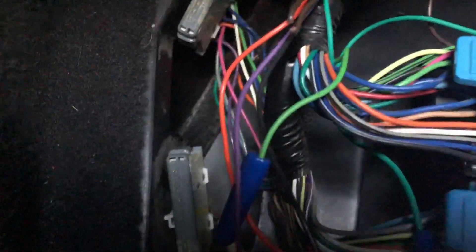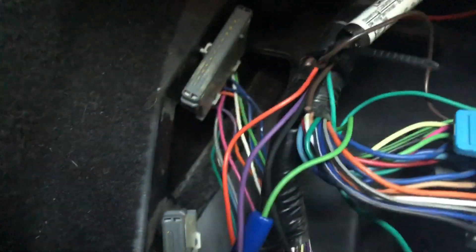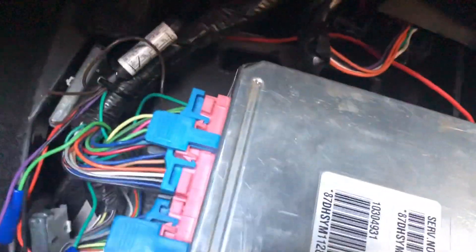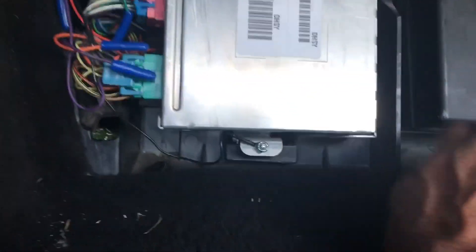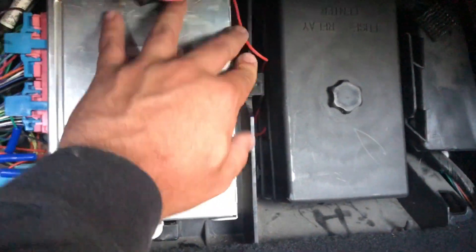Here it goes — point of no return — and boom, snip! Now I'm gonna dress up these ends with a little bit of electrical tape and we should be smooth sailing. Put the kick panel back, put the hooks back in the top, twist it down, pop it into place. These guys are taped up — not the cleanest job but I'm gonna get proper covers for them. Make sure everything is seated properly and all the cables are tucked into the cavity nice and neat — you don't want anything pinched.